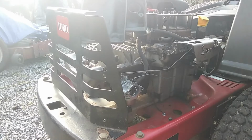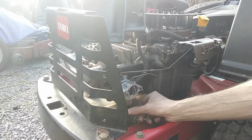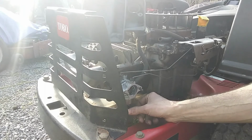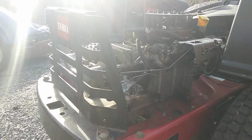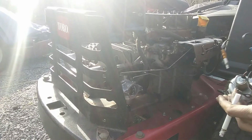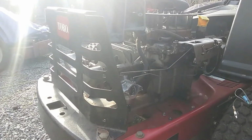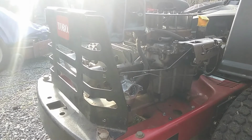All right, we're back after Mix. So it turns out this aftermarket carburetor didn't include the solenoid wire, even though it's included in their picture and in the description. If you're asking why I can't use this old one, this Walbro has the wire already built in, while this comes with a two-post contact here. I guess I could wire some stuff up, but I'm not going to do that. So I just took the solenoid off and cut the little pin out.